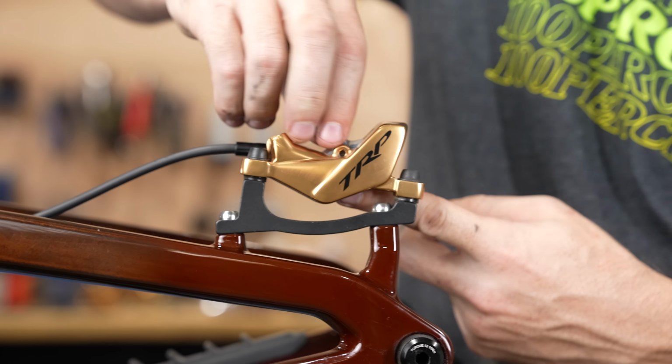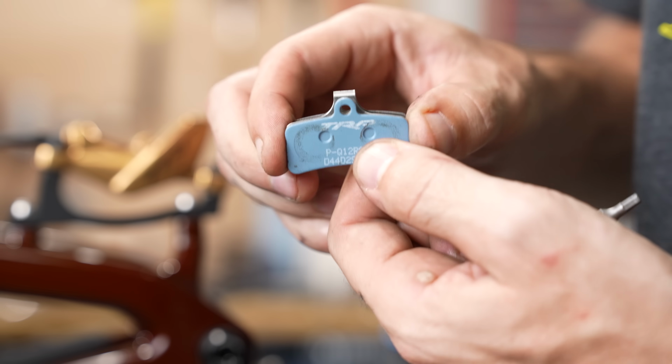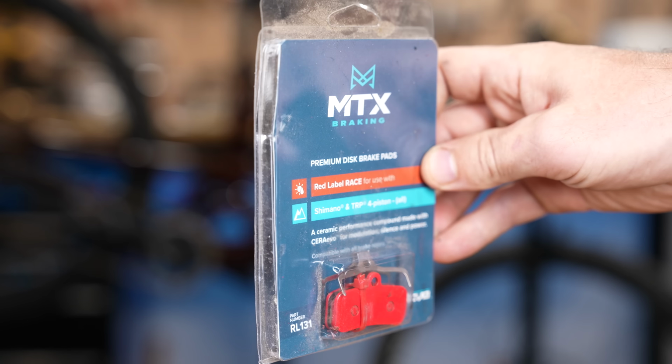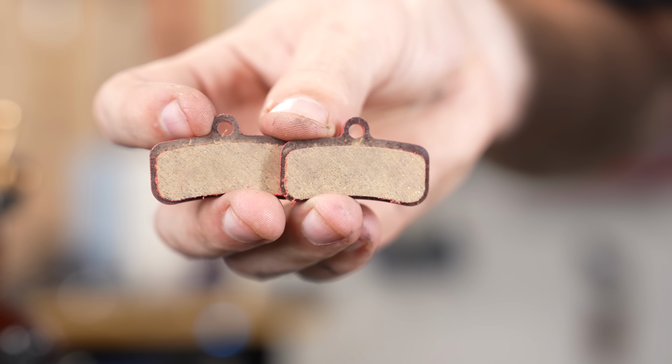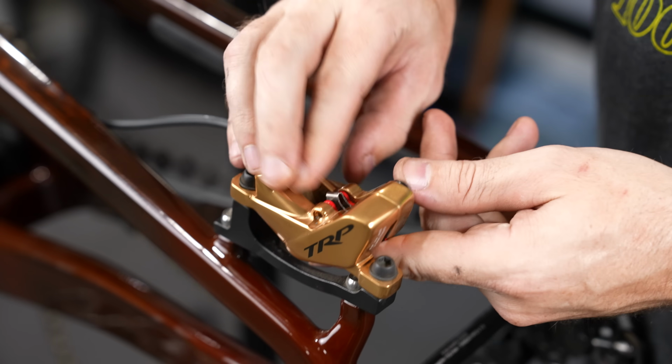And before I head out to go ride, a quick update on the brakes. Thanks to everyone's feedback, it turns out the stock resin pads are probably the culprit for mediocre braking performance. And it turns out TRP pads are the same as Shimano, and I just happen to have some MTX red pads on hand that I got from a subscriber, Nick Kendall, a few years ago,